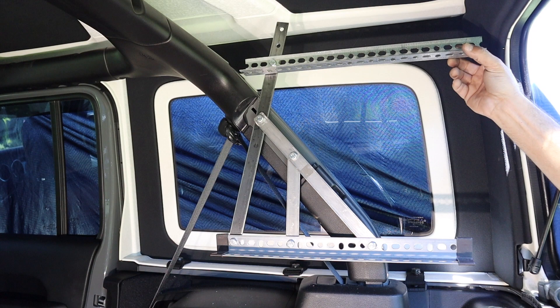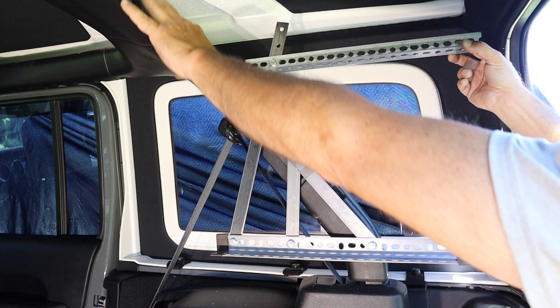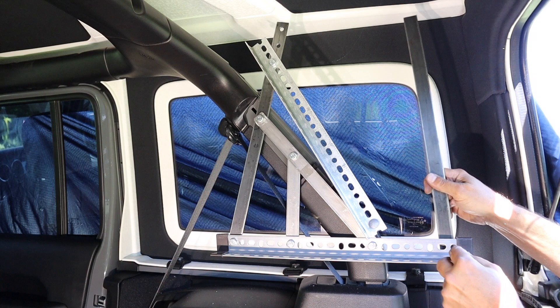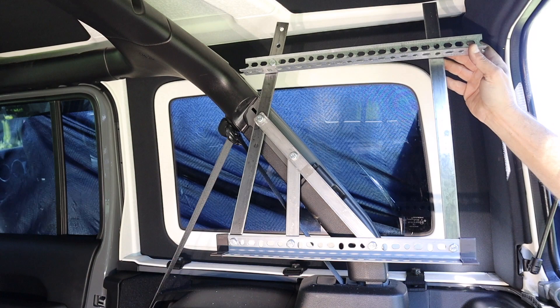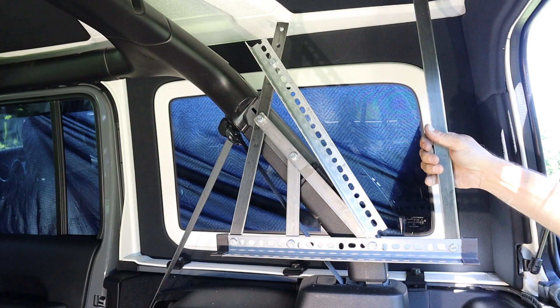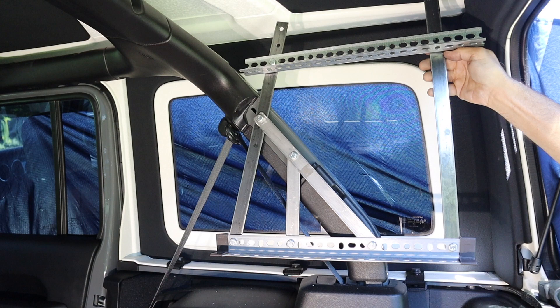So it looks like I've got about seven inches of height. I could lower it a bit, I could raise it a bit, depending on my needs. What I like about this height is I still have the crossbar holding anything from flying forward. And at any point in time I can change these heights. But I'll work with this for now. So now I'm going to put this piece here. Now this piece I'm going to make tight so that it stays vertical. And it's this piece that will adjust with the different adjustments up here. So when I want to lower this, I'm going to undo a wing nut and let this swing down like that. And this will be tight so it will stay vertical. But for now, I need to determine where to drill the holes for each of those levels. But for now, I'm going to stick with this one. I just want to make sure that I have it level.